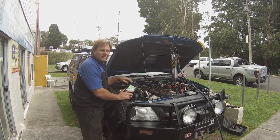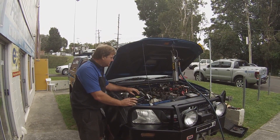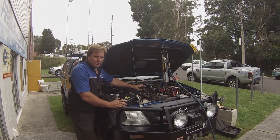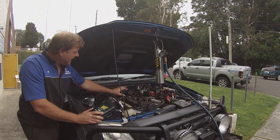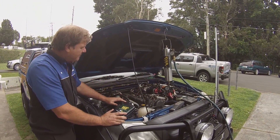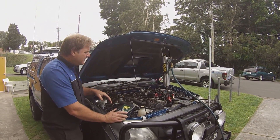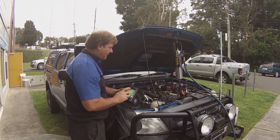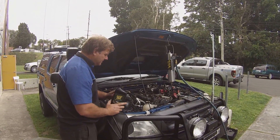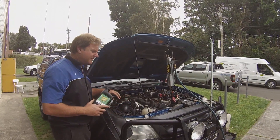So I've cleaned out the air filter box and cleaned the air mass meter. Looking through the throat of the throttle body — that's not too bad. It's now hooked up the Vortex-6 injector tool into the throttle body. So we've got one bottle of the solution running through it now. We've actually run two through the injector system as well.